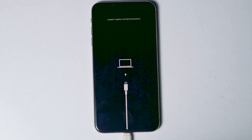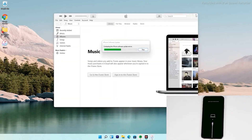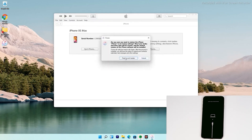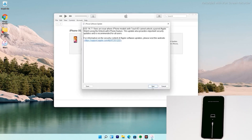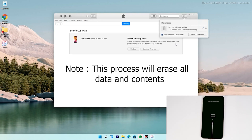As you can see, it has successfully got into recovery mode. From here you have to follow the instructions — the steps are the same for all iPhone models. There is an option to restore your iPhone; tap on that, then tap on Agree. At the top right of iTunes you can see that the software is getting downloaded — it is around 6.13 gigabytes. Note that recovery mode will not stay for long; if the download takes a long time your iPhone will exit recovery mode, but that won't affect the download. You can re-enter recovery mode once the download is complete and restore without downloading again. Importantly, this process will erase all content and reset the device to factory default.